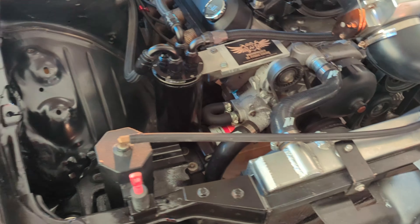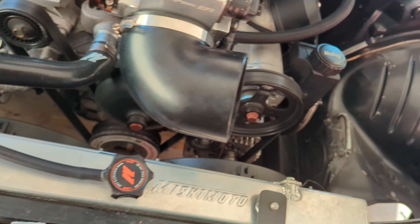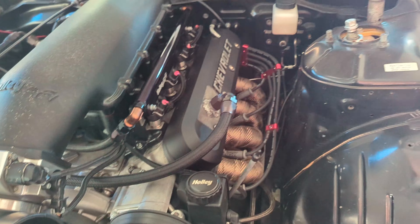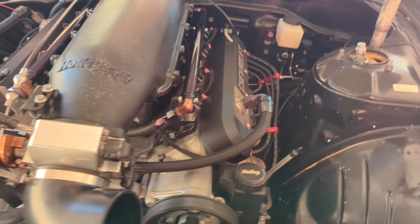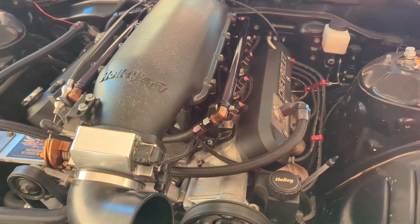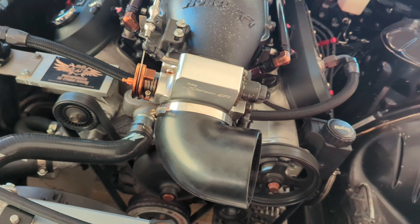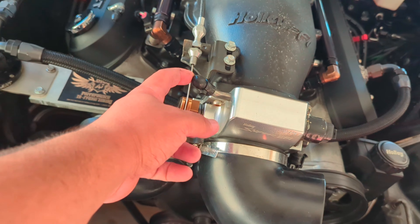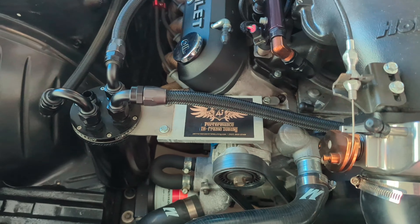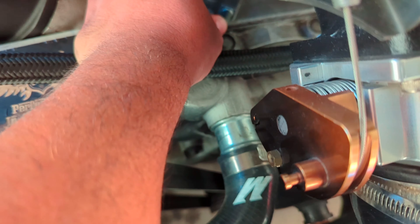Slowly the intake is gonna work. I'm definitely gonna nut-and-bolt the car. One injector here was not plugged in, so it was running and idling on seven cylinders. With it plugged in it idles — it just doesn't like to idle, so that's either a tune issue or something else to look into. Valves definitely need to be adjusted because they're solid lifters. Also all these nipples were pretty much blowing out of their place just because they're not zip-tied — easy enough fix, I did all those.